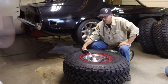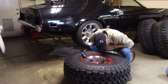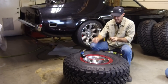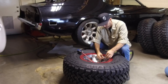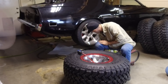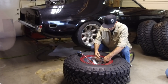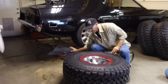I'm gonna listen here. We're gonna get it up to 35 PSI and listen for any air leaks around the rim. Seems pretty good. Let's go ahead and put the valve stem cap in — that just goes right in there like that. We ended up at 32.5 PSI so we're gonna set this to 30 on all of these for now. 30 PSI — seems to handle that just fine.